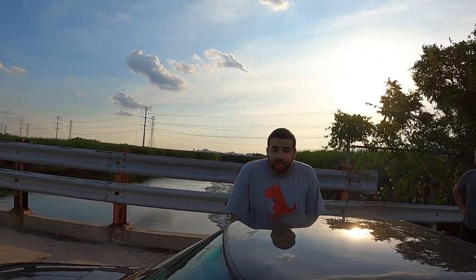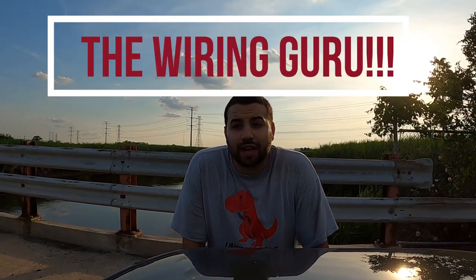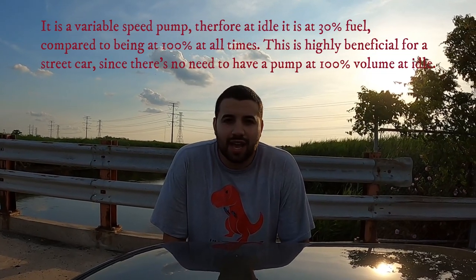What we ended up doing is using another output. Kevin, what output are we using now for the pump? We're using a map-based output — basically the ECU, once it reads a certain boost level, is going to activate the pump to run full tilt. It'll still run on lower duty cycles when you're cruising around so you don't waste gas. We're using a low-side output out of the ECU, which triggers the relay to activate the brushless pump to go on high duty cycle. We did have to run a relay to that signal wire from the pump.